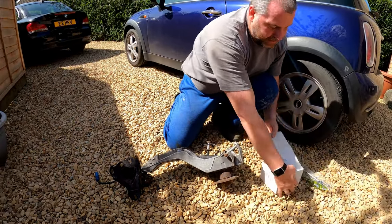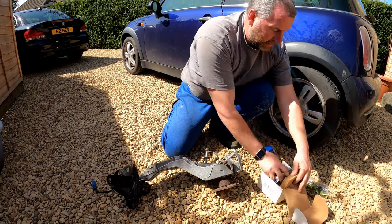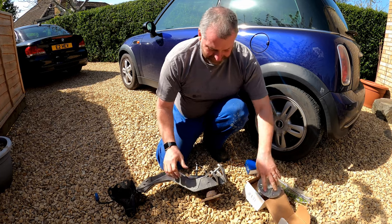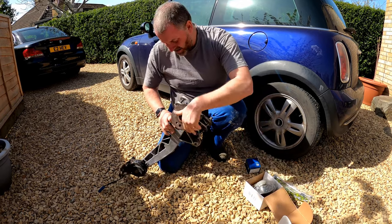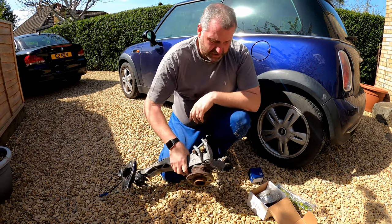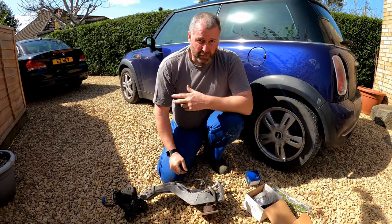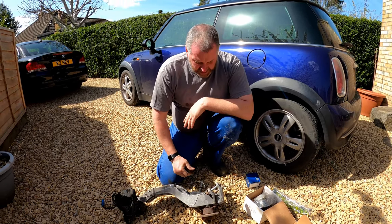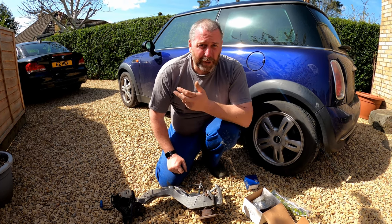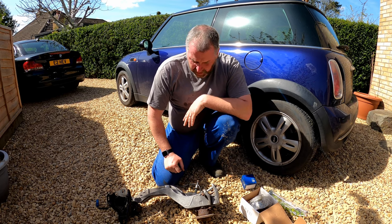And the other thing is a brand new wheel bearing. So that is going to replace this. Now, this one, there was a little bit of noise in it when I spin it like that, so that could turn into a drone at road speed. So while it's like this, it's held on with four bolts and they're pretty cheap, so why not replace it?